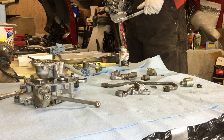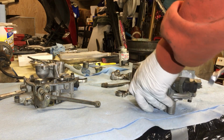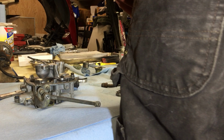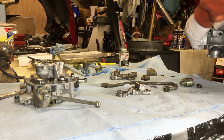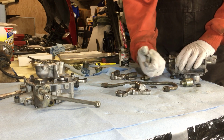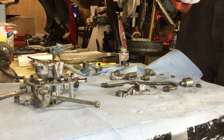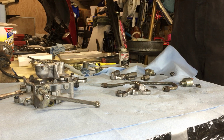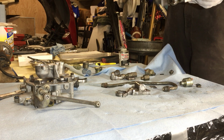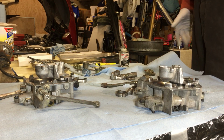Okay, so the fuel line's 17 foot-pounds, so a little bit tighter than the IAC, and I think that's what I'm doing, but just to make sure we know where we're doing here. Sorry, I thought I was supposed to do this. Oh, that's ridiculous. Here, let me just block the camera. Alright. Okay, I think that's a nice 17, and I think we're nice and tight. If there's any trouble, once it's on the car, I can still get a wrench on it, so it's not detrimental if you're not quite there. So those are good. Let's move on.